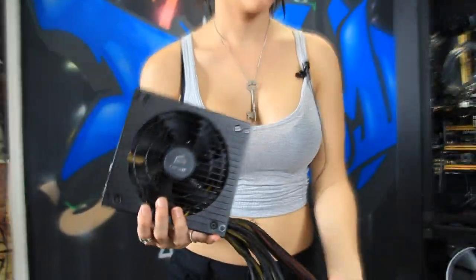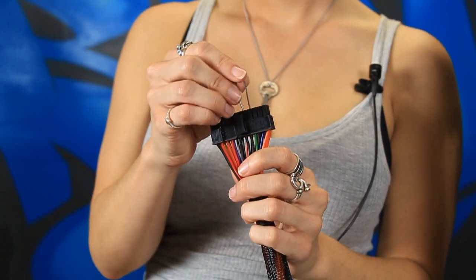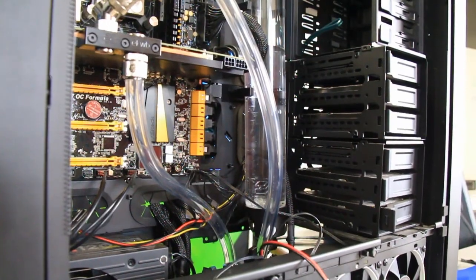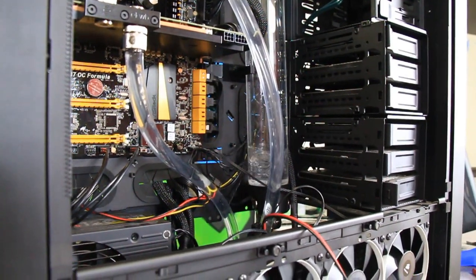It's step nine and everything is looking fine — let's prime the loop. We're using the Corsair 900D case for this build, and you can see how easy the super tower is going to make priming this loop. We're going to take an external power supply and connect the green wire and the black wire, basically hot-wiring it like a Camry. Remember to cut off the back switch so that there's no power before you put the paper clip in place. I like to test it out with a fan or a light just to make sure the power supply is on. Then make sure you have water running down through the res into the pump before you flip the switch powering the pump. Once you do, let the water push through and then shut it off before your reservoir is empty. You never want to run your pump dry because dry pumping is bad pumping. Repeat this several times until you're sure your loop is full.